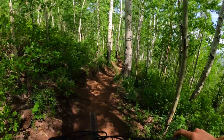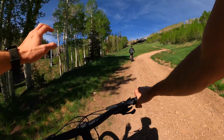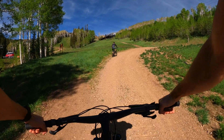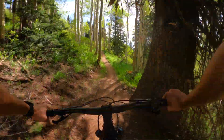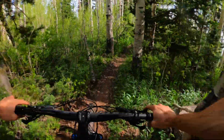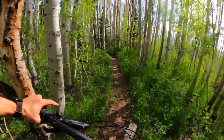One pro tip: I assumed climb mode would be the most efficient uphill, but it turns out that would actually be firm — firm is all about efficiency. Climb does something really cool where it tunes the rear but not the front, so you can still sag into your fork a little while the back stays firm. On steep climbs that means the front end isn't raised even higher by a locked-out fork, which would cause wandering and push you off the back of the bike. It lets you sag in, keep your geometry better, and stay over the front wheel. On flat ground or downhill, it basically puts you in sport mode. I wish you could do a climb-comfort split instead of just a climb-sport split, but maybe in a future version. I ended up preferring comfort for most riding and climb for steep climbs — comfort felt more like what I'm used to while still offering the benefits of firming up on climbs and rolling terrain.